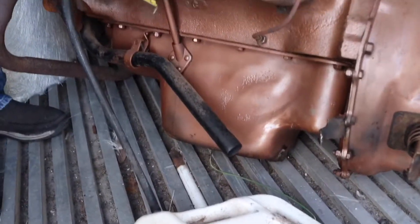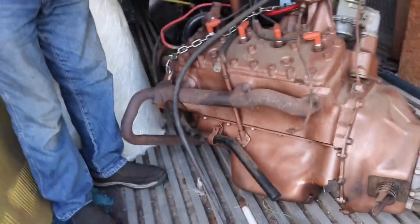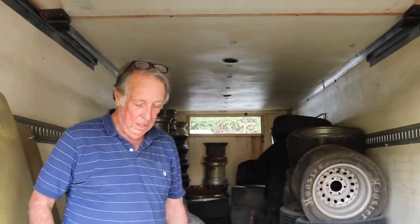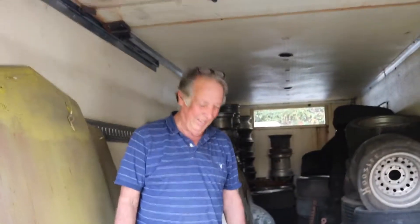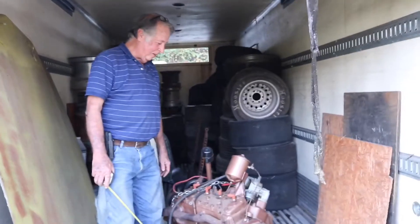What's this fitting here? That's what a PCV valve replaced. It comes out of the intake, goes under here, and goes out there. You used to see a lot of cars when they were giving it power, it was blowing stuff out of here like crazy. So the PCV valve took the place of that. I could see that being an emissions nightmare for folks — it never bothered me, but I think it bothered a lot of people.